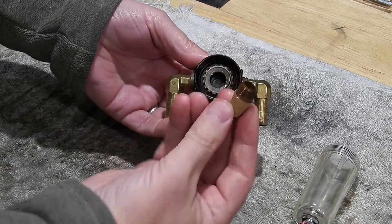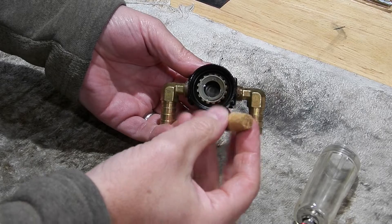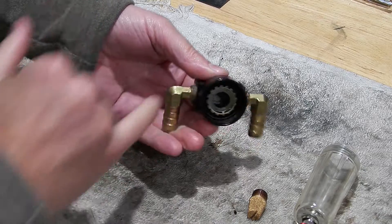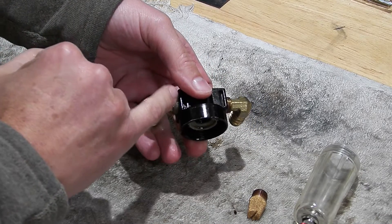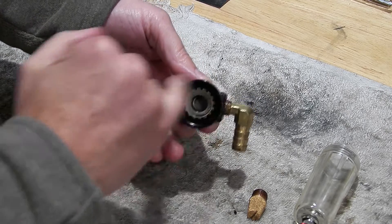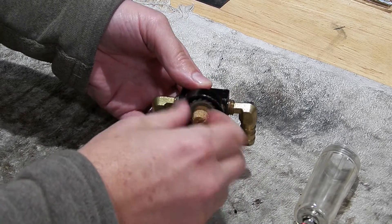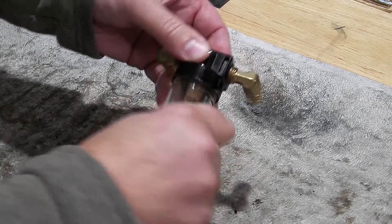And here you have a separator sponge and an impeller wheel. I believe that's a brass element with a micro sponge, which does a great job of filtering the air. And here you see an impeller wheel that tries to make the incoming air — which has moisture, gas, and oil in it — impel around to separate it before it goes up through the sponge and through the center. And that's a basic oil catch can.